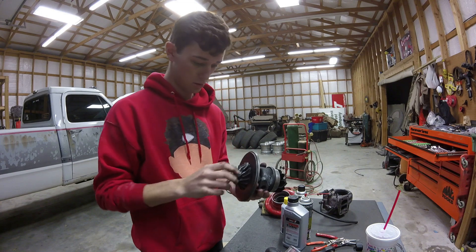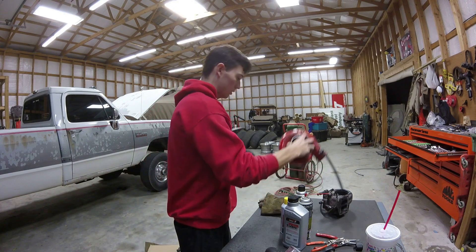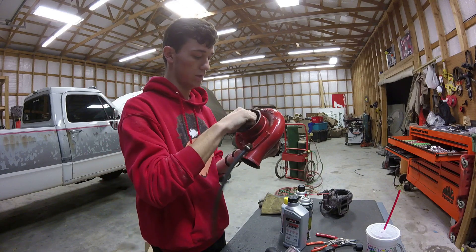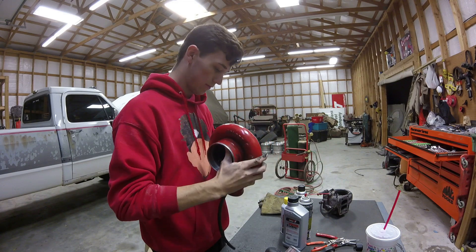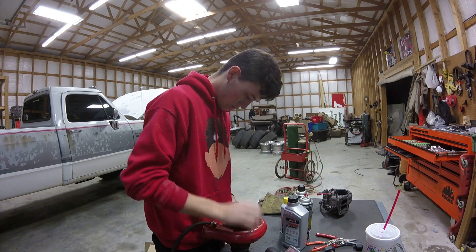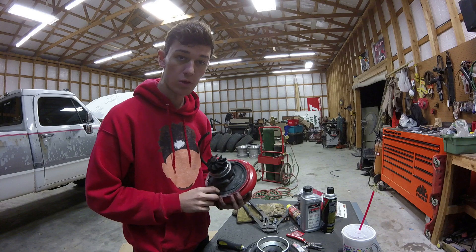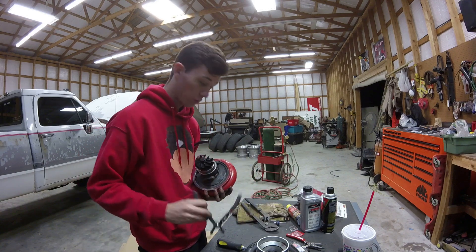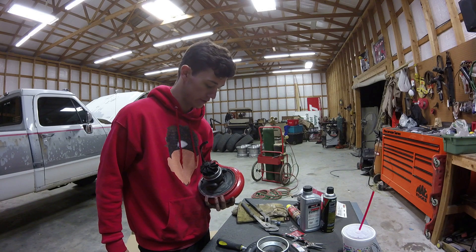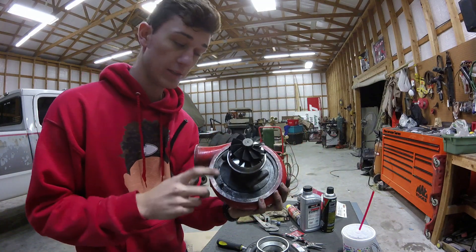Very free spinning, just like we want. There's hardly any play. This will be our compressor housing - unfortunately it's very ugly in my opinion. I finally got the snap ring on the back - that thing is just an absolute pain. Gavin is ordering new snap ring pliers tonight - the biggest set I can find. There are actually two holes for the snap rings, but the bias-style ended up working the best.